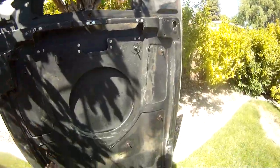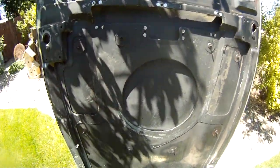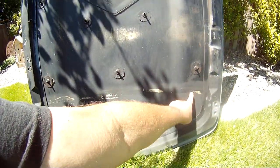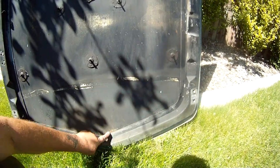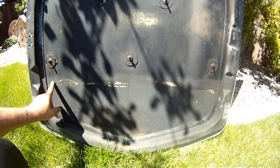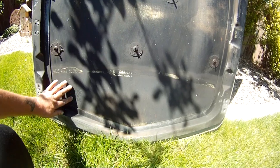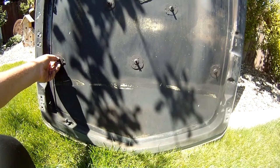This inner trapezoidal area gets heat shielding and sound dampening foam on it, and then there's a piece of foam in the engine compartment that runs across here. I saw in a video that somebody put foam all the way to the nose — it looked super cool — but it won't clear the foam that's already on the radiator, so they had to cut it and get rid of that piece. There are 11 of these clips that hold it in place.